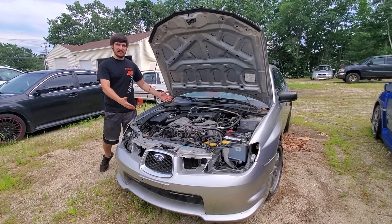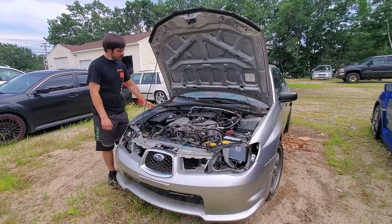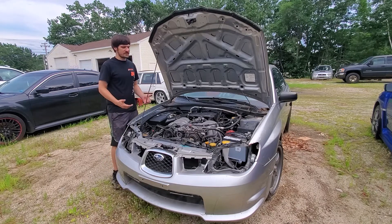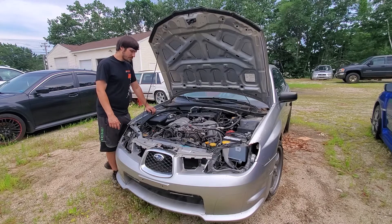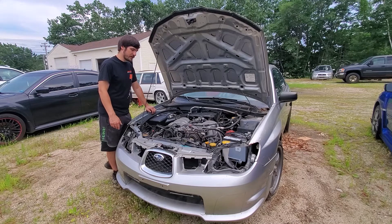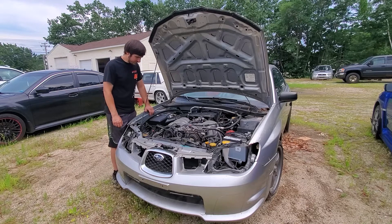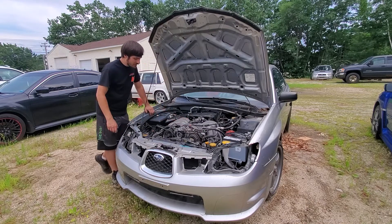This is what I'll be putting my effort into from now on. This is a JDM EZ30 — they came in Outbacks, Legacies, Tribecas, heavier vehicles like that. Supposedly this only has 45,000 miles on it. I don't know how much I believe that. Things like cam gears, crankshaft sensors — all that I don't know is the same, but because we're going with a MegaSquirt it's all gonna be the same to me.